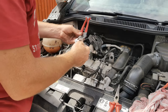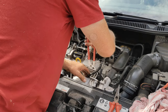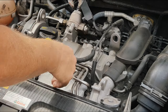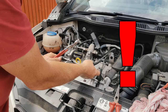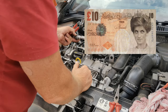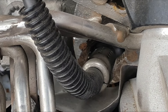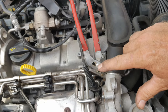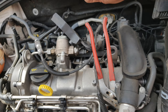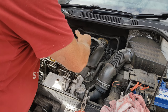Go in down here with a pair of pipe grips and get them around the top of the connector. Once you have, you can use the cam cover for leverage to lift it away. Don't be tempted to pull the lead because you could well pull the leads straight out of the connector. Lean the pipe grips on the cam cover and push down on the grips, holding them together to get some leverage. Don't squeeze too tight — we don't want to crush the connector.